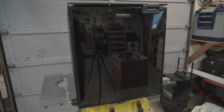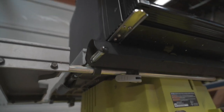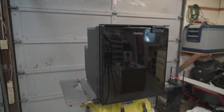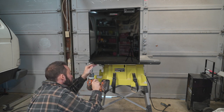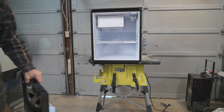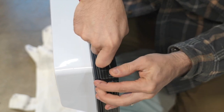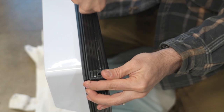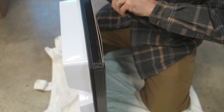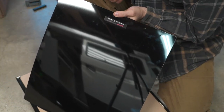To get the black face panel out to put the Formica in, we come down on the hinge side, take out a couple of those four screws, leave the last one, and let the hinge hang down so we can pop the door off the front of the fridge. Take the bottom of the fridge door and you'll see a little gap — about two grooves back there's a little line you can push in there and kind of work it, and this here will pop out. We unscrewed the hinge and now it should just slide right out.